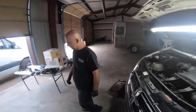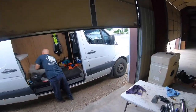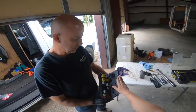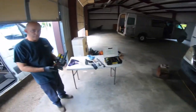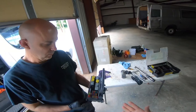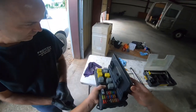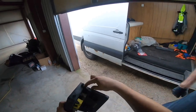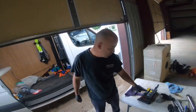There's a SAM. That SAM was kind of throwing me off, Mark, because I showed you — you have the SAM right here. This is also called a body control module. So this is a BCM — body control module — and they call it a SAM. Just in case you guys hear SAM or BCM, that's actually what they're talking about — it's this piece which actually plugs in. Have you tried taking this off yet? I have not. So you take this bolt off and then simply pull over here and this unlatches itself. You pull it this side. So this is good that we have it.